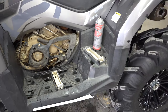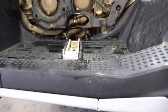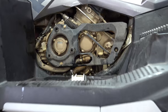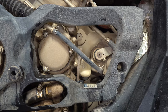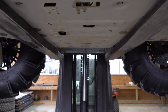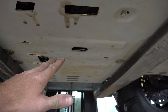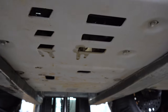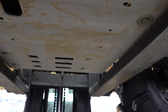Since this is a full service, we're now moving to the transmission. We're lifting it back up to be able to get to the transmission drain plug, and I went ahead and cracked open the dipstick for the transmission to let it breathe so that it will drain a little easier. Now keep in mind this may look a little different under here than yours — the stock skid plate is a little bit easier to get to everything. Mr. Joel is going to show us exactly where.